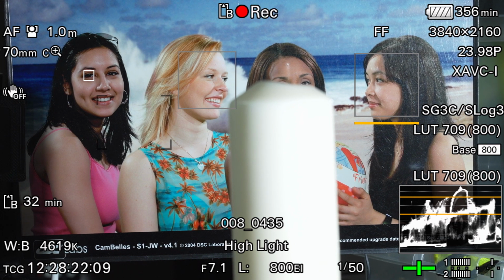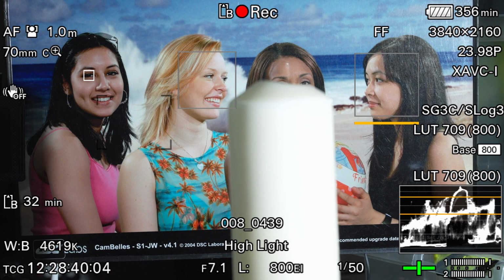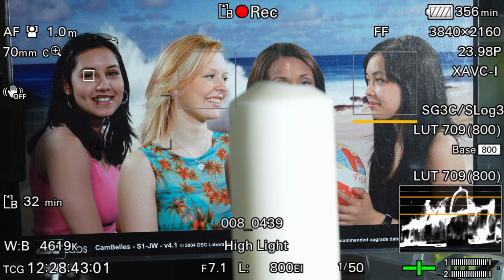But if you start trying to record multiple clips or do anything fancy, very quickly you can trip this up. And especially as the card fills up, it will eventually give an error. I've just formatted this card so it's quite good, but as I know with this particular card, as it fills up, it becomes much slower, and it will eventually give me an error, and when it gives you that error, it actually can be quite catastrophic.